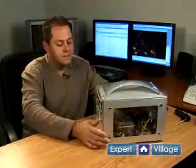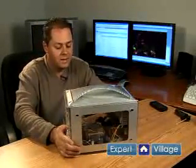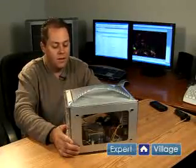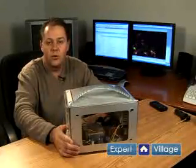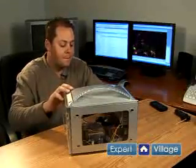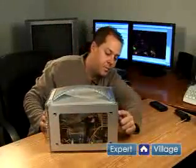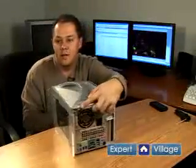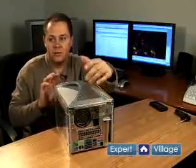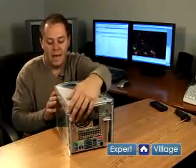One of the most important things is you need to watch out for static electricity on electronic components. Static can fry your circuits very quickly. It just takes a second of touching the computer in the wrong spot, and you can fry the circuit board or anything like that. I always recommend that you touch the back of the case by the power supply. Any time that you might get away from the unit and come back to it, you want to touch it. That'll discharge any static that you have built up on you before you open up a case.